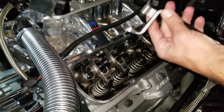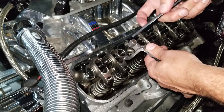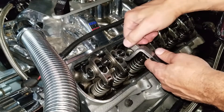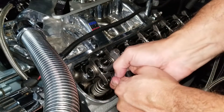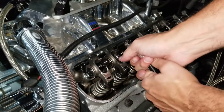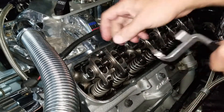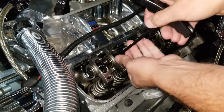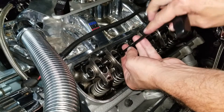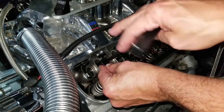There's a tool that goes right on the poly nut, and another tool that sets the lock nut — we don't need that yet, we just need to break these loose. They can be stubborn. So these are loose now. I'm making sure the lock nuts are backed out because I don't want any accidental preload, so I'm backing out those big set screws.